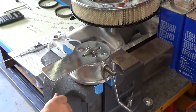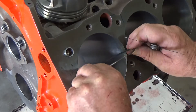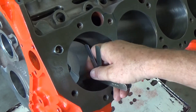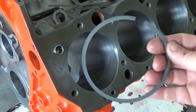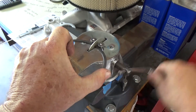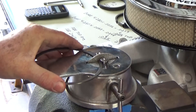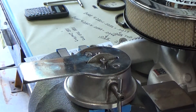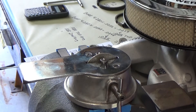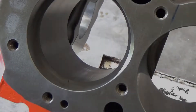Here's my ring filer — I just clamp it in the vise. I'll take a number one ring, stick it in the bore, and use an old flat-top piston to push it down in the bore to make it good and square. With feeler gauges — I've got a 20, a 22, and a 24 — I'll file with the ring filer until my 20 goes in, then be more careful, cutting a little more at a time until I get my 24-thousandth snug fit for the top ring. The first couple cylinders take a little more time, but you get a feel for it.